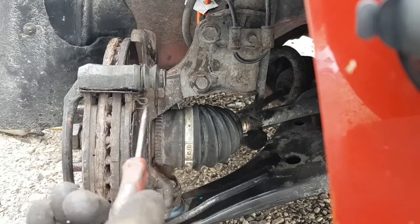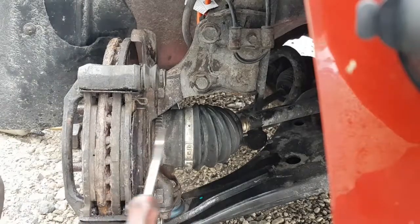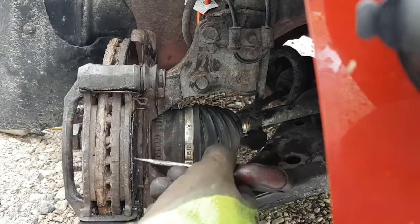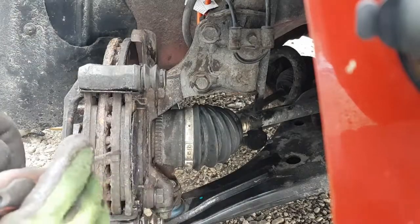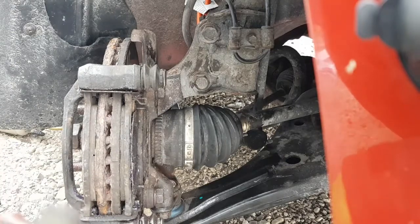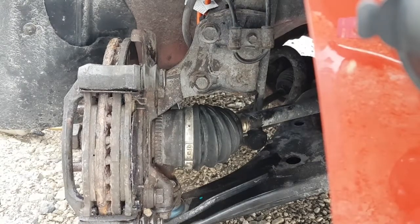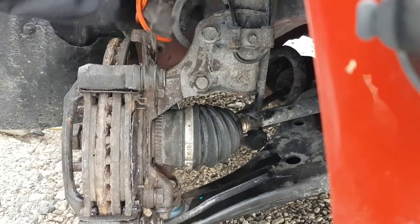Usually, if it only has a squealer on one pad, the pad with the squealer tab is the inside. More often than not, these squealers go on the inside pad. The inside pad wears out first because it's direct off the caliper piston. It doesn't have to go through these slide pins. There is a bit of friction in these slide pins when you actuate your brakes, so the inner pad, as you can see, is worn out more than the outer, and they always wear like that. That's why usually you put the squealer tab on the inside. All right, now that we're done with the theory, let's get the caliper on here.